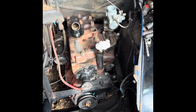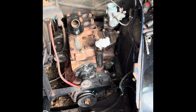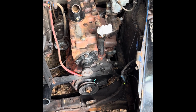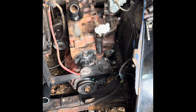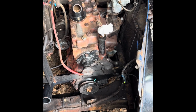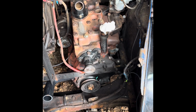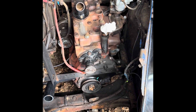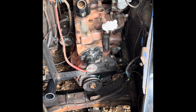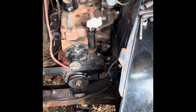Well, we got the engine starting to go back together now. Got the cylinder head back on with a fresh head gasket, cleaned up all the mating surfaces of the block. We've got the new water pump on. That did fight us a little bit. New old stock obviously isn't any better than just buying stuff that's made in China nowadays, it seems. The holes were slightly misaligned, so I had to enlarge them slightly, and then the gasket didn't fit either the block or the pump, so had to make my own gasket for that as well. But we've overcome those bits.